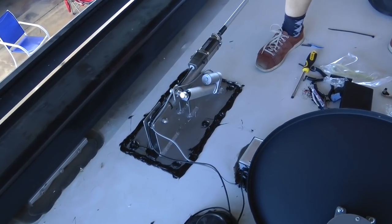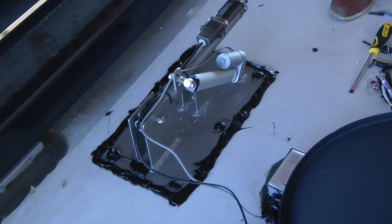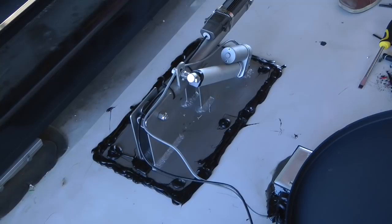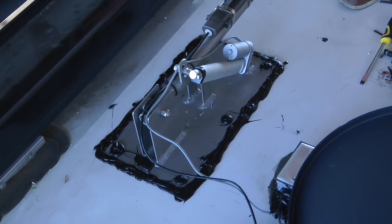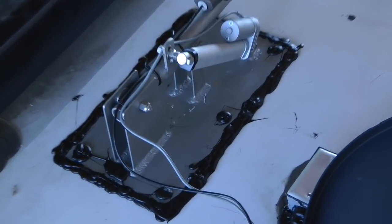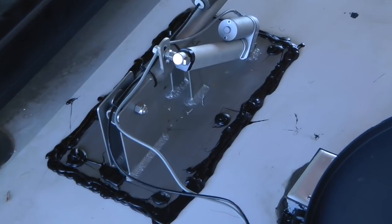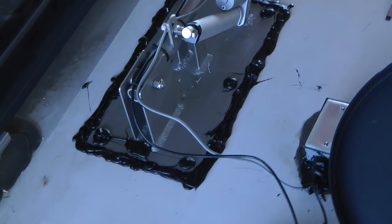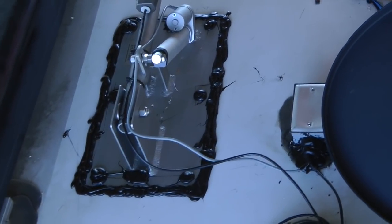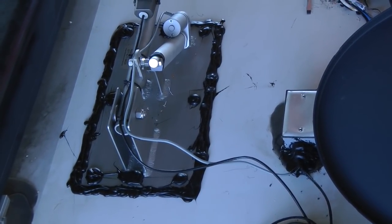Covered it all in the lap sealant, Dicor I think it's called, and that will actually find its own level now, and so that's completely sealed from the elements, and even the tops of the bolts are sealed. That way you get no water when it's raining going down the bolts and into the roof space. So yeah, it didn't take long to do, probably 2 or 3 hours, and that's it really. We're good to go.